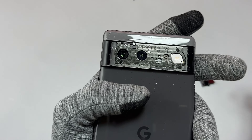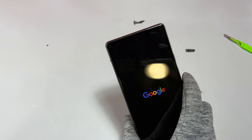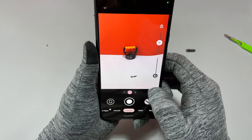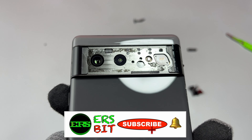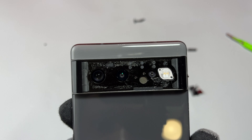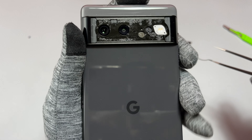For this type of damage, we can be reassured that there was minimal contact between the dust created by cracking the glass and the cameras — the cameras are safe 90% of the time. This is very important: you need to test the cameras, the video feature, everything — all the lenses — before you install the new camera glass. You need to be assured that your cameras are functional and that you do not need to buy or replace any of them.